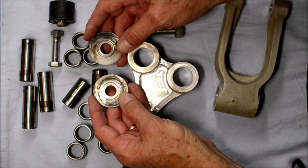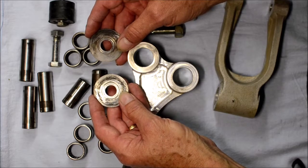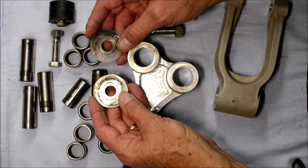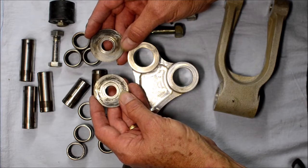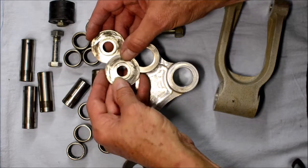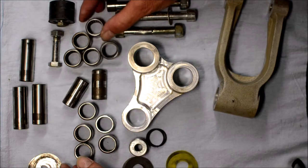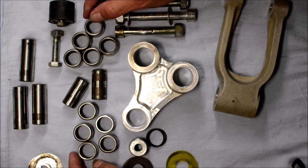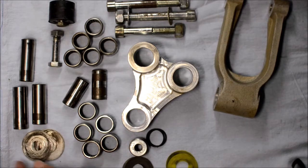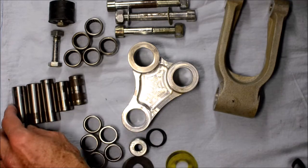There's no provision to lubricate, clean, or protect those surfaces, and every time your back tire distorts sideways the load is taken on these washers directly — and they're showing it. It's soft steel; you can see the imprint from the bush. I'm up for 10 of these: five of them had rust in them and are at action level, and the other five were okay. I'll be changing the full set — they're available from Radio Spares for about 14 dollars each.